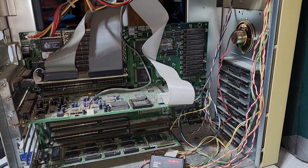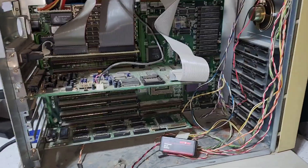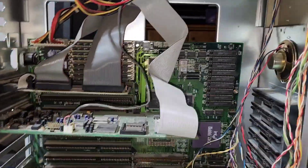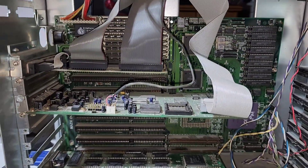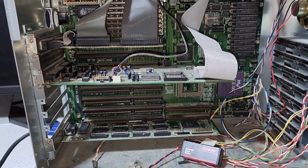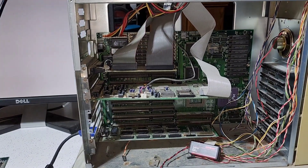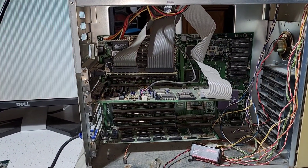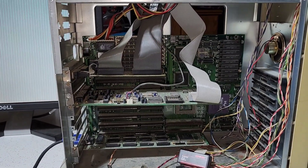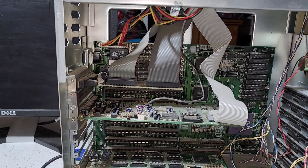There's a hard drive in here but I don't know if it has an OS installed or even works at this point. This is farther than we got before. Going to turn it off, hit the turbo switch, and see if that makes any difference. We've got turbo engaged — and now seven beeps, repeating. So a new beep code this time around. Going to hit reset and see if that holds.